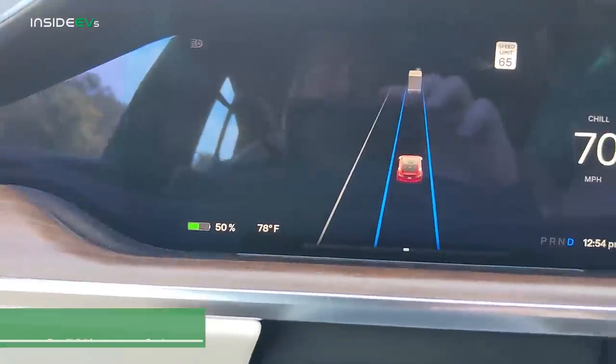We're at the 50% state of charge point — halfway home — and we hit that point at the 145-mile driven mark. We lost a little bit of range; I was expecting to pull in at about 150 miles since we did 75 miles in the first 25%. If you extrapolate out, that's 290 miles we'd finish with. The interesting thing is we're actually a little more efficient in this leg — we finished with 316 watt-hours per mile versus 317 watt-hours per mile at the 25% point — yet we delivered less total distance.